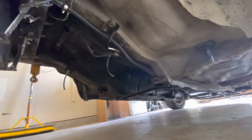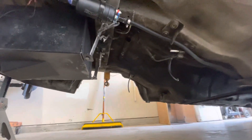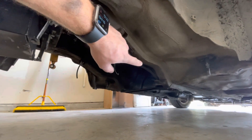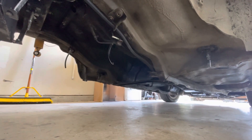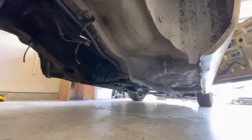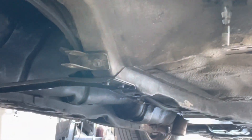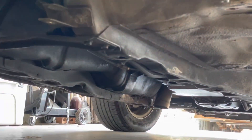Here is the space we're working with. The axle is going to live right here, and I'm going to try like hell to use these same coilovers — not sure how much longer I can make them, but we'll work on figuring that out. We need to find somewhere to mount our ladder bar brackets up here in the front. I think this little rail that rides along here is probably going to be our most structurally sound component to link to — it looks pretty perfect. Right up here where the turndown is, I could reinforce that with some steel plates, weld it all the way around the edges, and weld our bracket to that. I've also been wanting to use some extra chromoly to do some subframe connectors up towards the front to create a little more stiffness in that chassis area.